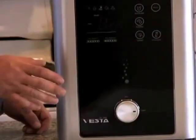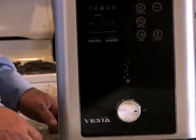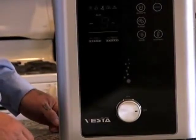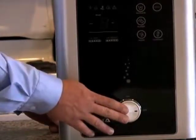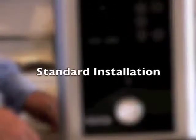One of the most important features is the water flow control knob. This simply turns the water on and off, but anywhere in between restricts the flow and slows the water down inside your ionizer. This is important because flow rate directly affects the level of ionization you can reach. So if you want super strong alkaline or acidic water, this knob comes into play. It also controls all water going to the ionizer, which matters for the different installation options available.